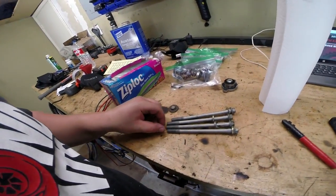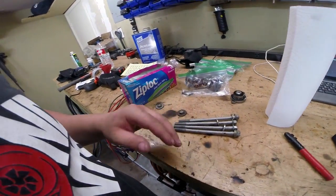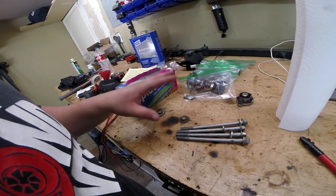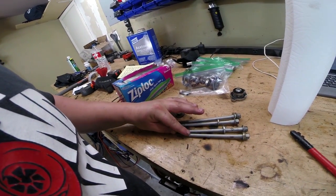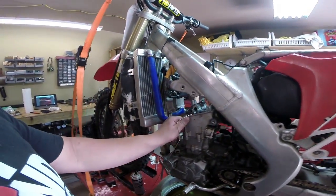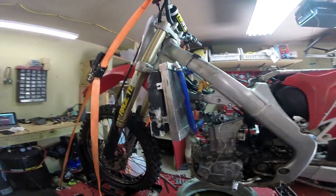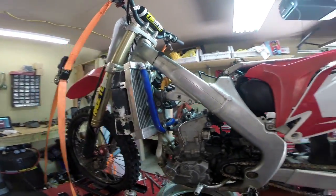Here are our head bolts — I labeled them. These head bolts are usually stretch bolts and you never want to reuse them. It's nice to be able to go back and measure them to double check what you're ordering. A lot of times the rears will be different from the fronts. Now with that removed, we should be able to just take a small mallet and get the head busted loose, pop it out of the intake, and take it out the side of the frame.